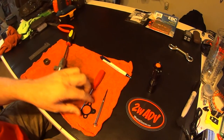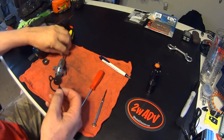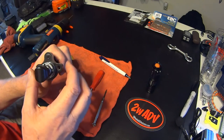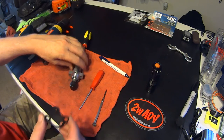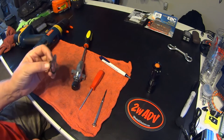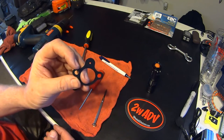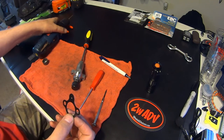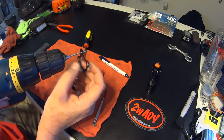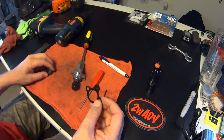Let's talk about the gasket — this is why you need a drill. The gasket hole that feeds the oil port of the adjuster from the factory is 0.5 millimeters — it's extremely small. According to some guys on the VFR Discussion Forum at VFRdiscussion.com — I got the rebuild info from VFR QQQ and the gasket information from Spud786 — he opened his up to about 2.75 millimeters. I got mine at about 2.25 millimeters, which is roughly a 3/32 drill bit. I drilled this metal gasket and opened that hole up, which should give you better oil penetration within the inner workings of the cam chain tensioner and hopefully help it last longer.